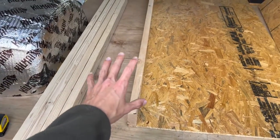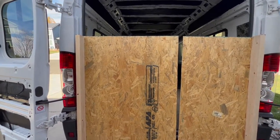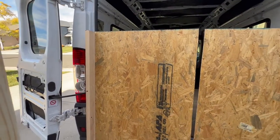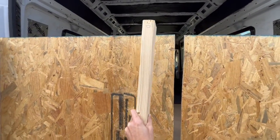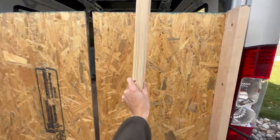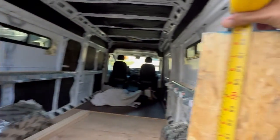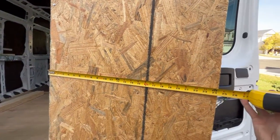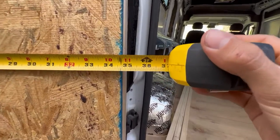Now that there are six total beams I'm going to show you the last step. You'll notice that one of these pieces of plywood is bigger than the other. The reason is there are six total beams and there's not exactly one that sits in the middle so it's going to be a little offset. You'll have a beam on each side, then the second, third, fourth beam where both boards will lay on, fifth beam, and sixth beam. The bed dimensions are very awkward so I was forced to buy two large sheets of plywood and cut them to specific sizes. The total length of each piece is about 68.8 inches long. The small piece of plywood is just under 24 and a half inches wide, and the big piece is about 34.6 inches wide.